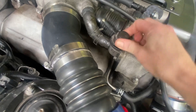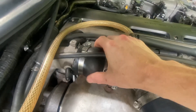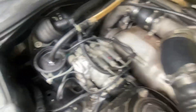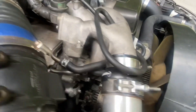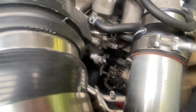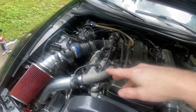It's just crazy how they did it — I don't even know if the lines are hooked up the right way. I want to delete this thing but I gotta find something to put in this hole, make a custom plate. These stupid hoses are temporary — stuff I pieced together when I deleted the PCV valve. The wastegate under here is welded all the way open, I'm pretty sure. It's a very confusing type of system.